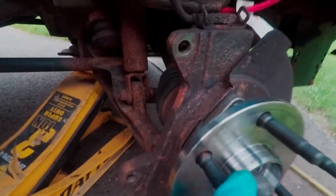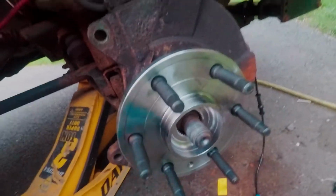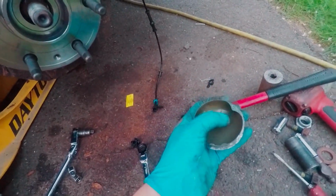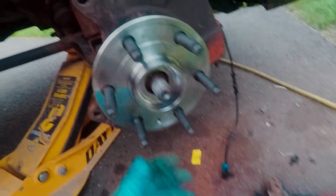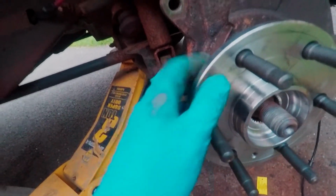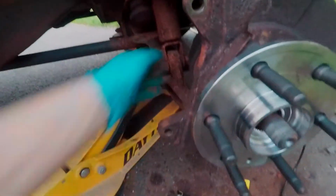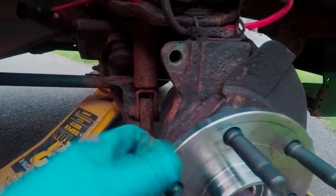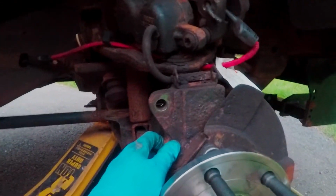So I got all three of those hub bolts tightened down, and now my next step is going to be to throw on the axle nut and then see if I can put this cap on. Maybe I'll bend that out a little bit, but throw the cap back on after the nut. Everything's all greased up in the axle, so it slides freely in there, and it should clamp good with the axle nut. Yeah, I got all three of these cranked down really good, important.